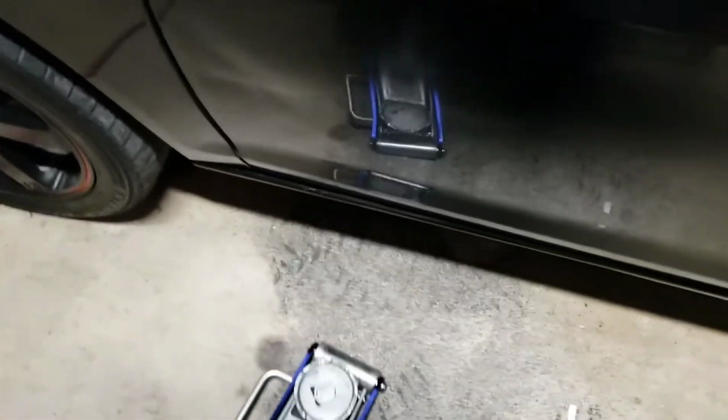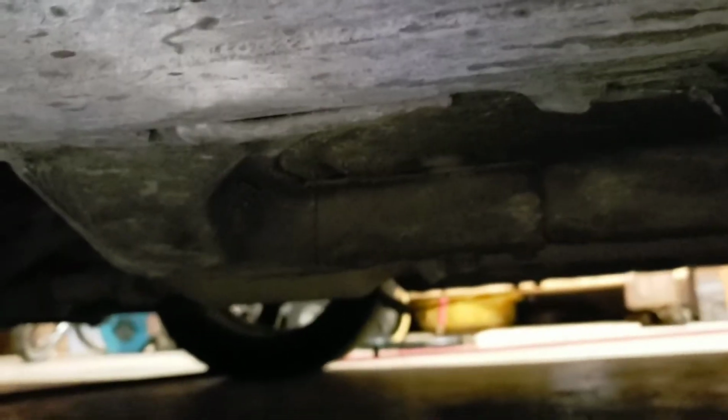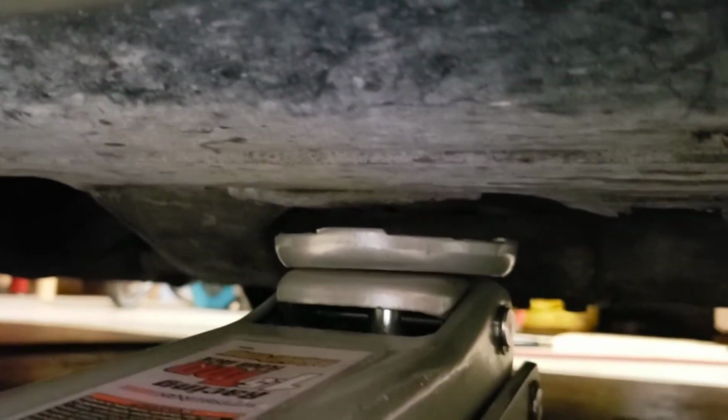So step one, you're going to put this under your car and locate the jack points. My car, they're broken, but it is right there. So you're going to put that under the car. Make sure the jack is twisted to tighten, to actually raise it. Now go ahead and start lifting it up. Make sure it's lined up properly on that right there. Alright, jack it up.